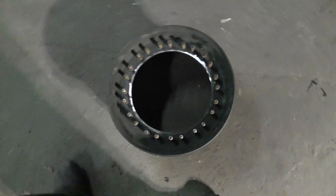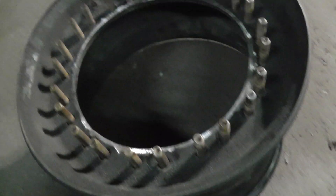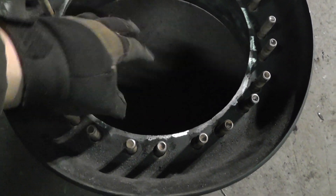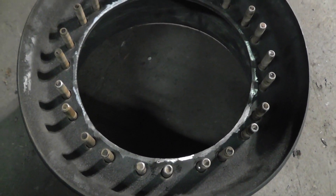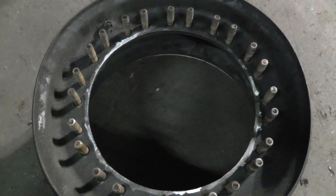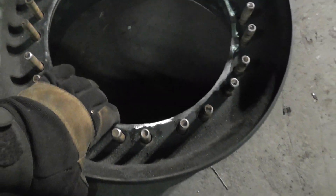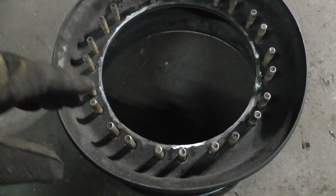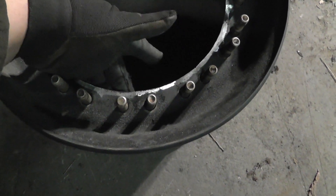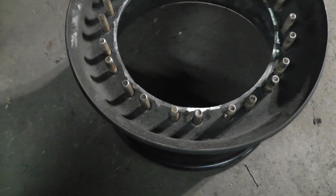This one's done — let me show you how it's going to look on the rear section. There you go: big giant hole, and then the wheel center will press into the back section of the wheel. There'll be a bit of a gap in between where you bolt it in. Some wheel centers are flat, some are a dish type. For the sake of preserving these wheels — and they are really thick metal — I'd suggest making sure there's enough drainage so water or snow accumulating inside this lip can drain out through the back section rather than puddle up. That's my only suggestion.